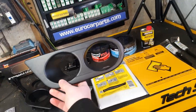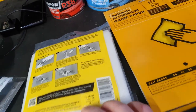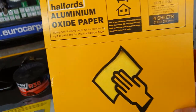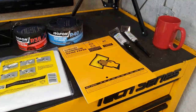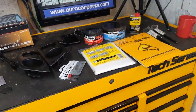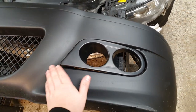These are the things that you need — I bought them from eBay. We're going to use some fiberglass sheeting, possibly the tissue just to make it a bit smoother. For fillers, you need a fiberglass reinforced filler and then a smooth finishing filler. Aluminium oxide sandpaper at 80 grit to get all the rough filler down, then wet and dry sandpaper to smooth it out. You also need your resin with your hardener. This is all stuff you can get from places like Halfords — it's relatively cheap.